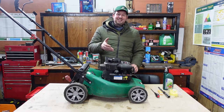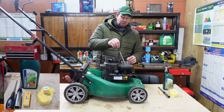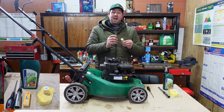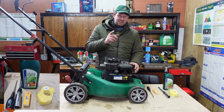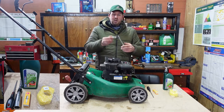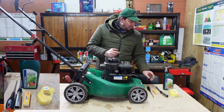To get this engine serviced, all we need is a flathead screwdriver for undoing the screw in the air filter, an NGK spark plug — it's a 1147 B2 LM. I was on the phone to the dealer and that's what they sent me through according to their records. We need a 19mm spanner or socket to undo that spark plug; I'd normally put them on either a ratchet or a small adjustable, depending on how difficult they are to get at.